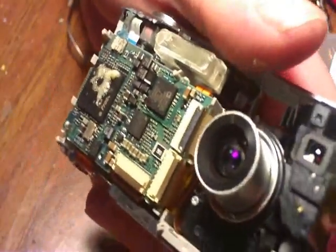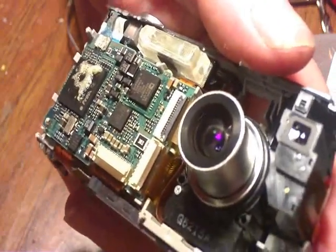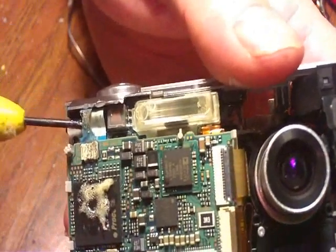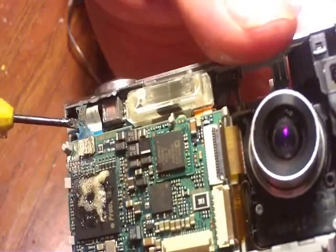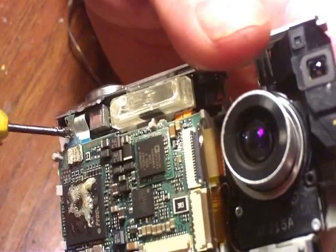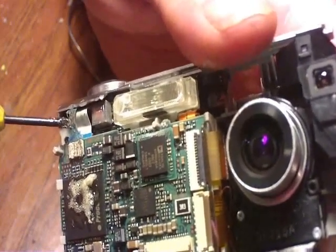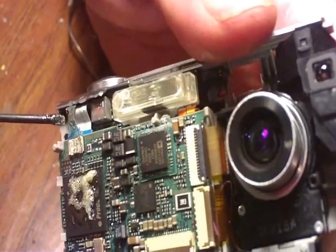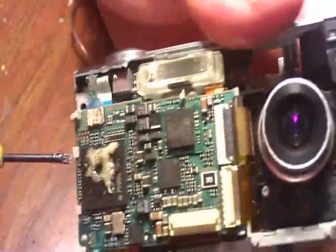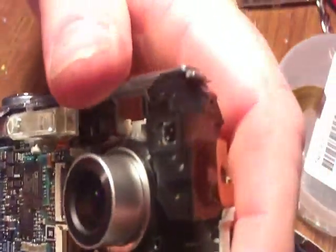You can also see how much heat damage there is — the heat off a 30-watt iron will do that. He didn't even have to hit it with the iron; just the heat off a 30-watt iron will melt this blue ribbon. I've said numerous times not to use a high-temp iron, and this is what happens when people do. I have no idea what that stuff is.